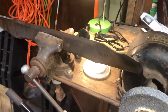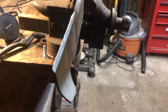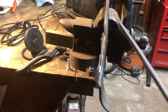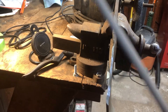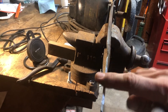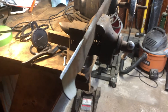Now that your blade is off, you want to sharpen it. The best and quickest way is with a bench grinder; if you don't have one, a good old-fashioned file will do the trick. Here is the cutting edge — as you can see it tapers up. File in that direction, just keep filing in the same direction one way until the edge is nice and sharp, then repeat for the other side.